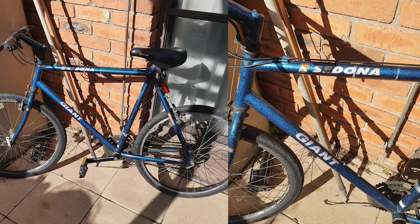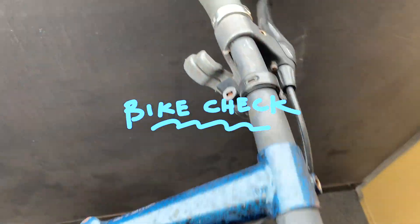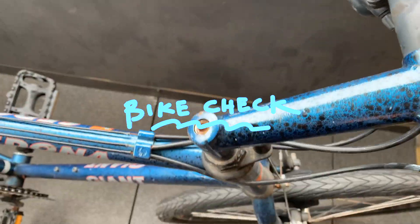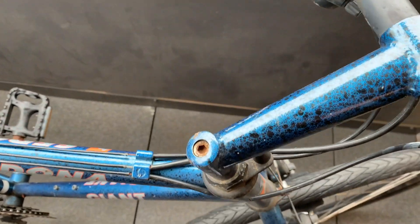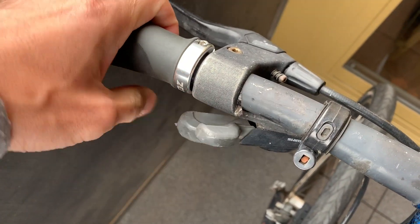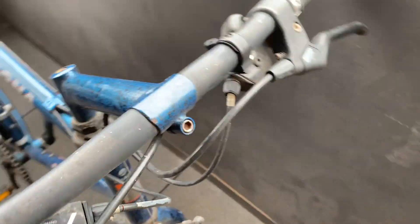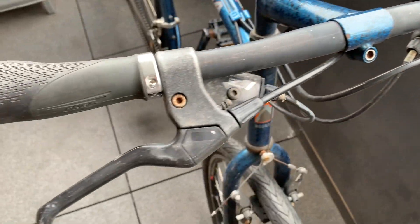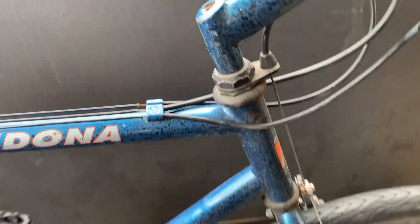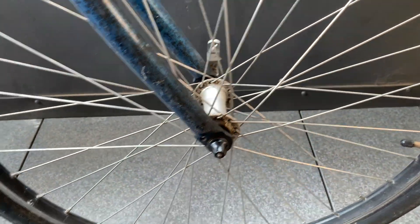When I got the bike it was a little bit bigger than expected. Got the bike back — here it is. It had a flat tire so I just kind of wheeled it home. The headset was pretty creaky straight away — I noticed it didn't turn that well. And then when I tried shifting the gears on both sides, it just didn't work. I didn't force anything — I just knew how to fix those. Everything seemed pretty cool, just a few scratches here and there, no dents or anything. So that's good.